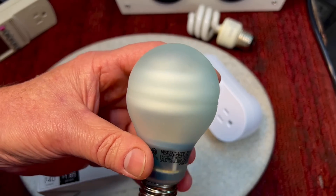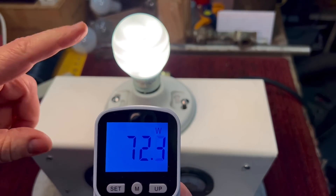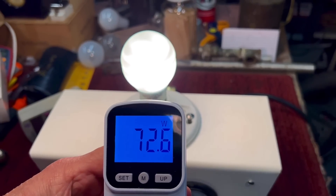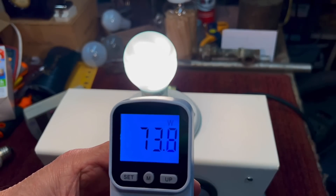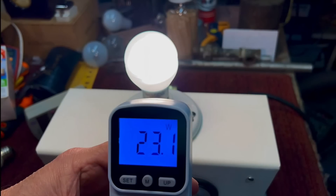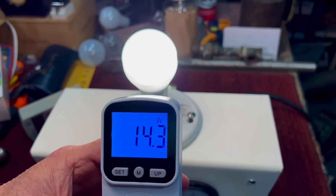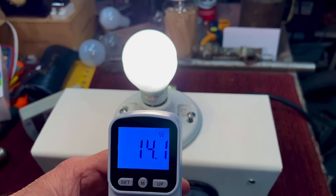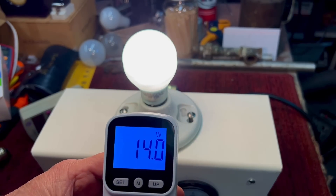If you had this above your basement stairs, you wanted something bright as you go down — this filled that niche. Let's plug it in, turn it on, check the wattage at startup, and then see what the wattage is once the halogen shuts off after it warms up. We have it on wattage — turning it on. See how bright that is? That's the halogen and the compact fluorescent together — it's using 72 watts. We wait about 40 seconds — I have it in time lapse — and you can see the wattage drop drastically. The halogen kicks off and now it's down to 14 watts. It's at full brightness with just the compact fluorescent. It went from 75 watts on startup down to 14. Isn't that cool? I love this bulb.